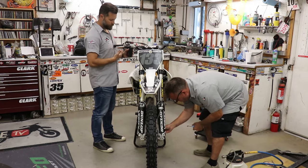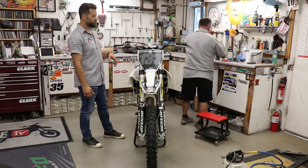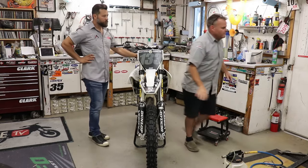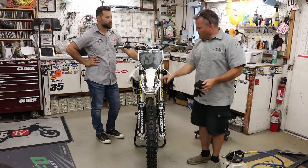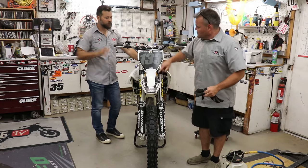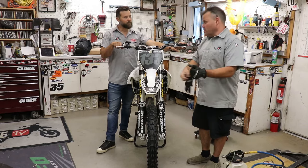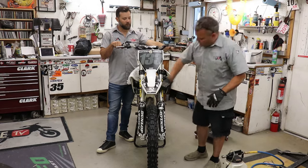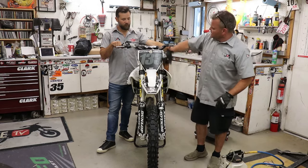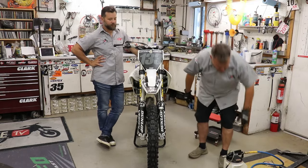We're pretty good right now, but we're gonna do the final step - and this is the key here. So the final step is back bleeding - I'm gonna push fluid up through this line. I'm trying to get fluid to come up here. Don't pump anymore, because now every time I do it, he'll pump it just three or four times and then let go. Tap it like this - it's letting air bubbles up to here. It's good to put a zip tie on here overnight - we'll talk about that.